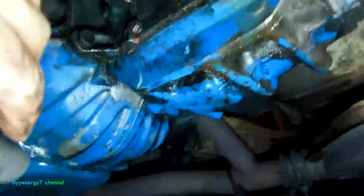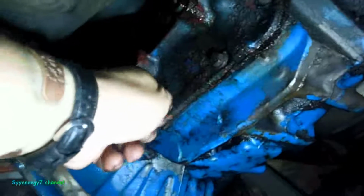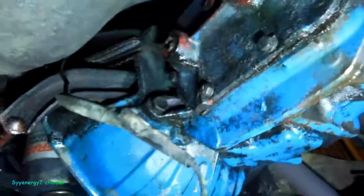Okay, so I took the 3 levers off, you don't have to mess with the adjustment or anything. You just unbolt them. I put the 3 bolts down here in order. It doesn't matter, really. The little one goes down here for the reverse. You take off the backup lamp plug. Next is to take off this cover, as I already got these loose, and put the pan underneath there.